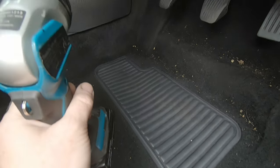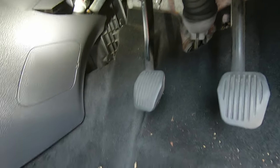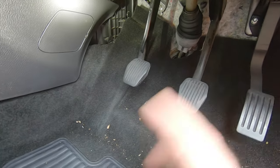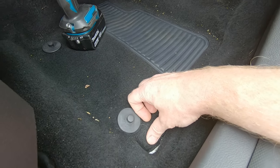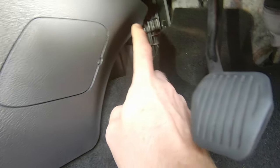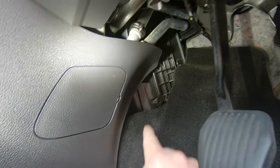I've got a bit of a mystery coolant leak - it turns out it's actually coming from the heater matrix pipes, which are hidden up here. There are two silver pipes that come through the firewall with two black clips, and they've been leaking coolant. It would basically go from maximum to minimum on the bottle level over a period of about four weeks. No matter where I looked I couldn't find the problem in the engine bay.